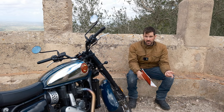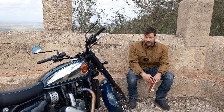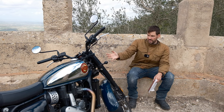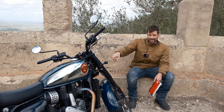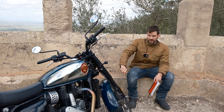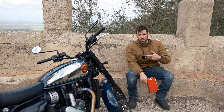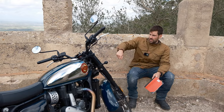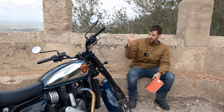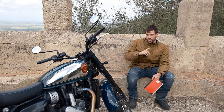Being an early adopter is now part of the parcel with Euro 5. I've had my engine management light on twice. The first time was when I crashed the bike — there's a little gyro sensor that kills the engine when the bike falls on its side. When I righted the bike and turned the ignition on, I had an engine management light, but it reset after three cycles of turning the bike on, going for a ride, and turning the ignition off. The other time was when I rushed the startup procedure. You're meant to turn the key to ignition on, sit on the bike, side stand up, and let the clock sweep from one o'clock all the way round and back — wait for the engine management light to go out, then thumb the starter. If you do that, you'll never get an engine management light on.